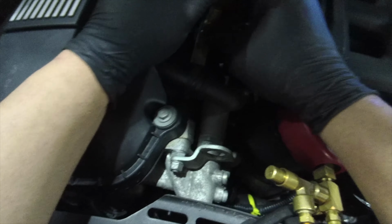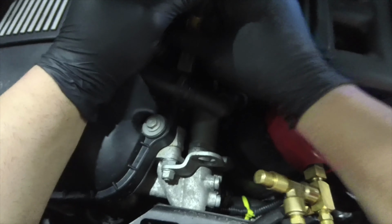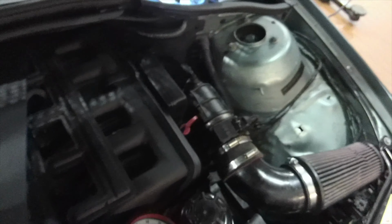After the fuel filter installation was finished, I wanted to make sure the fuel rail pressure is on spec and that the fuel pump is working normally. There is a Schrader valve, almost like a tire valve stem connection, on the fuel rail itself that a fuel pressure gauge can connect to very easily. I got it and start it.